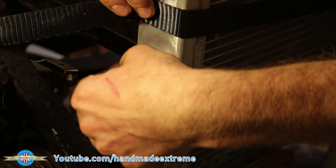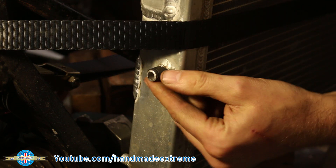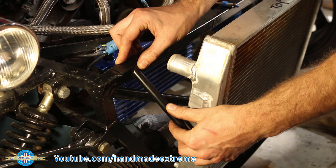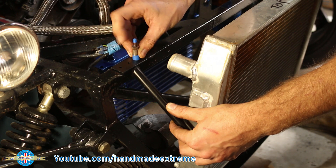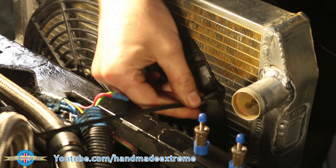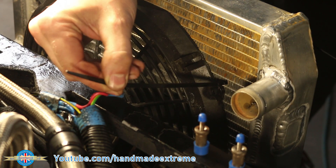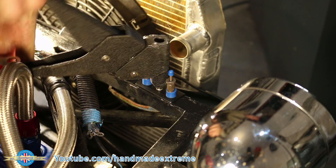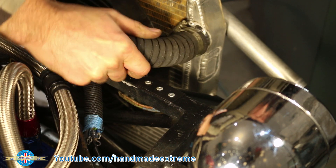Where the radiator goes into the radiator brackets I wrapped some self-amalgamating rubber tape — this acts as a compliant barrier layer between the two metal parts and stops them rubbing on each other. With the oil system done it's time to fit the radiator. I'm using the skin pins again to locate the radiator bracket on the rivet holes — these are really good and once you get the knack you can fit them one-handed. The cooling fan just slips in the gap between the back of the radiator and the front of the chassis, held in place with four cable ties which go through the radiator core. I could then pop rivet the final radiator bracket into place.